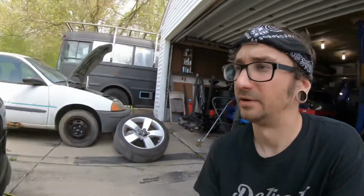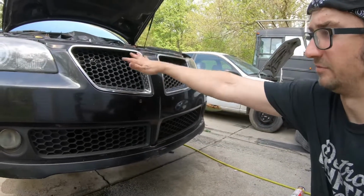So we're going to be making our own custom end tanks for it and all that, obviously, and we'll be sure to do a video on that when I build the intercooler. As for the radiator, it's getting V-mounted still. Probably going to need to delete the AC to clear the downpipe, just because of clearance issues and how I want to actually build the turbo kit. So AC is probably something we're going to have to delete unless we can find a cost-efficient electric AC compressor.